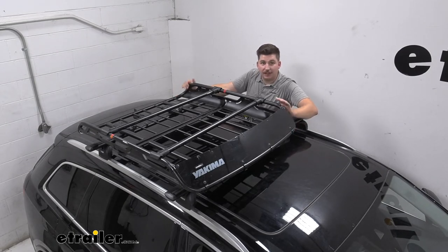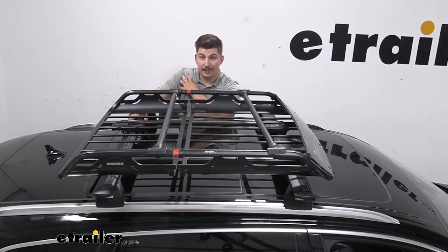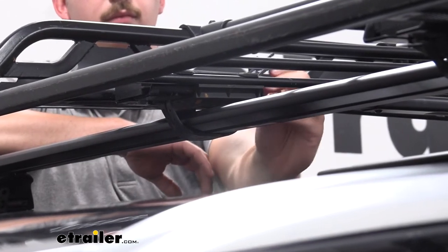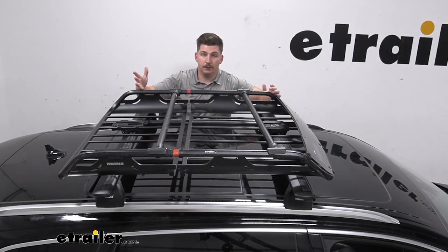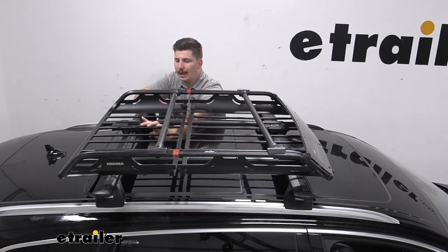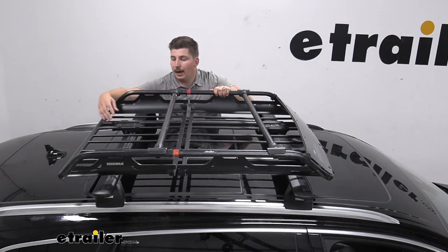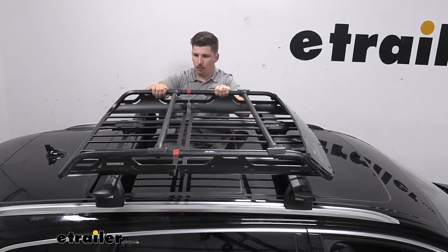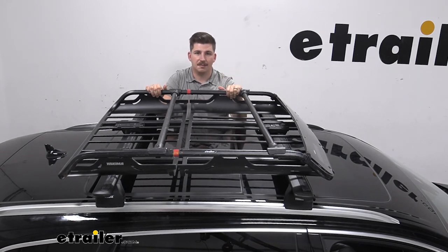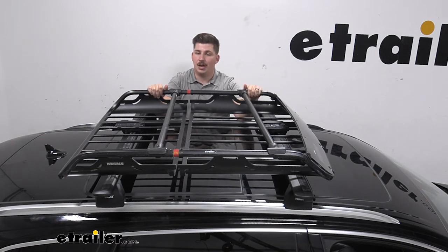Just be mindful of having everything secured down properly so nothing shifts on you. As far as how this attaches to your roof rack, I really like the system this has. It's got these thin bands that wrap around the crossbar and will secure up to these sliding tracks here, so it's really easy to get it adjusted to your roof rack depending on your crossbar spread. Then we can just add that lever in, throw it down, and pop this end in to lock that lever in place. Out of the box it doesn't come with lock cores, but we can add them for that security aspect. It gets a very strong hold of the basket on the roof rack and it's super easy to get installed. Once we've got it set for our crossbars, we don't have to worry about it — we can take this basket off, and the next time we put it on, all the settings are going to be proper and we can get that latch down even quicker than the first time.